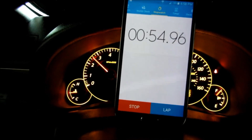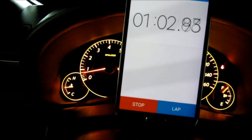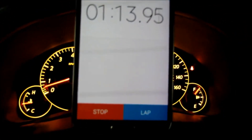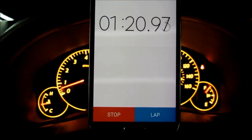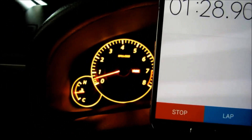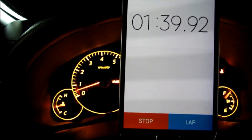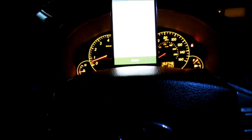When the car is on, let it rev a couple of times to make sure the idle is right. Give it a couple of revs. This is how you do your idle relearn. You need to do the idle relearn any time you disconnect the throttle body, and also if you're getting a high idle which throws engine code P0507 — that's when the engine isn't idling at 650 RPM where it should be. After letting the car idle for 20 to 25 seconds, the idle relearn procedure is complete.